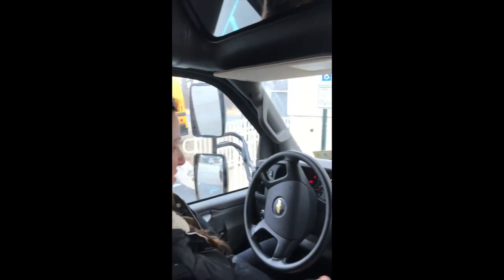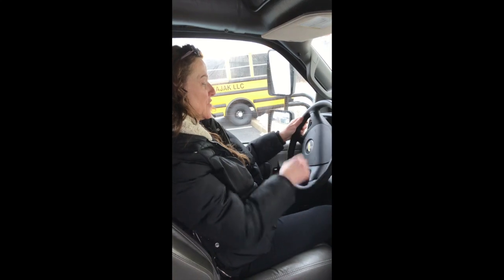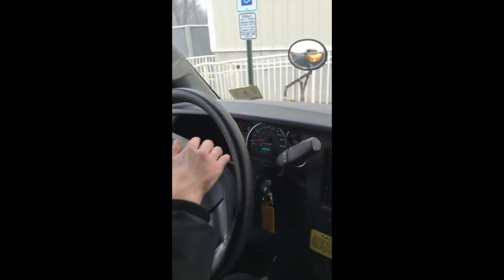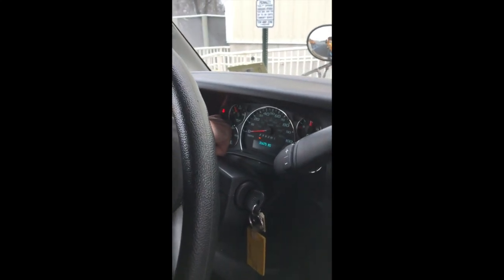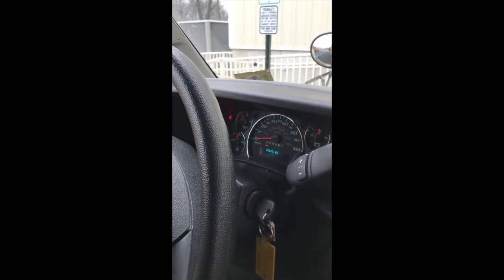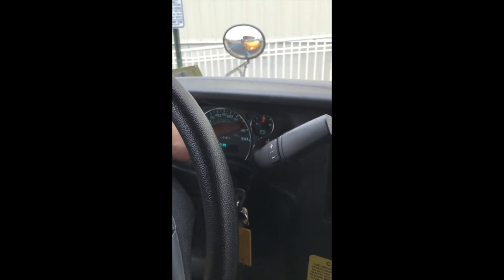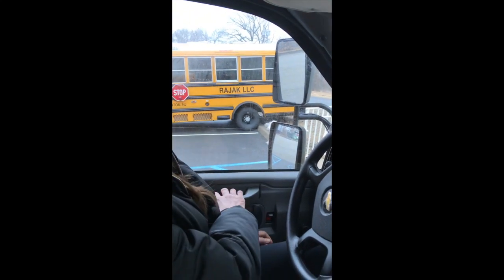The inspector will come back in, sit down, and say start. Since you've already turned the engine on, leave it on. Tell the inspector: the dashboard is clean, your ABS light went out. Do your gauges — oil should come up to around 40, probably around 30 here; the bottom gauge is your temperature around 210; your speedometer — you'll test it when you test your gas pedal because that's when the knob will go up. Your battery should come up to 14 and you have gas in the tank. Also do your door — open and close it, say the door opens and closes properly.